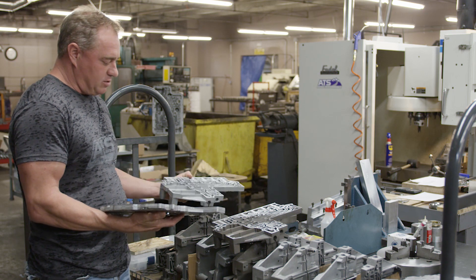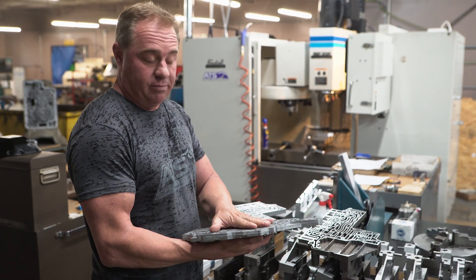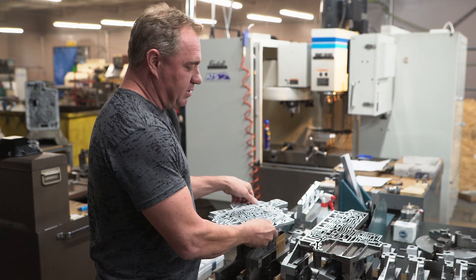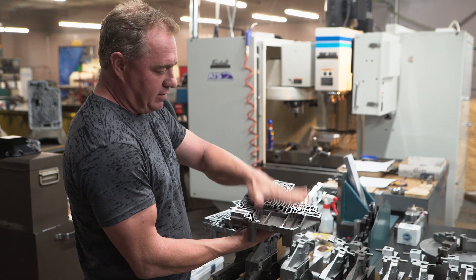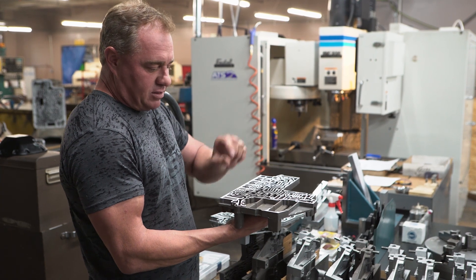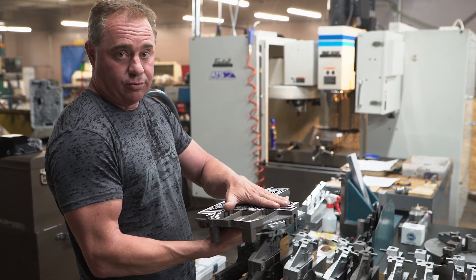There are a lot of manufacturers out there that are adding gaskets between the separator plate, which is definitely not a bad thing by any means. The gasket really does help, but it helps compensate for a lot of this warping that takes place in these two pieces. So you have 10 thousandths on this side, 10 thousandths on the other side — as much as 20 thousandths variance. When you have gaskets it really does help with cross leaks, but it doesn't do the best job in the world.